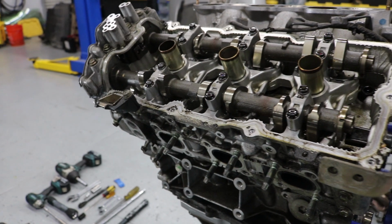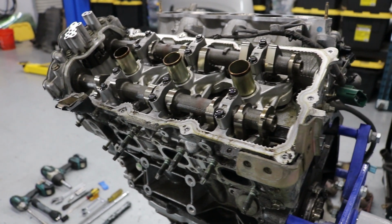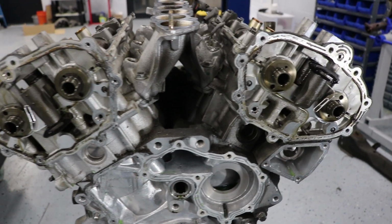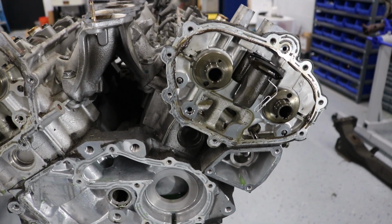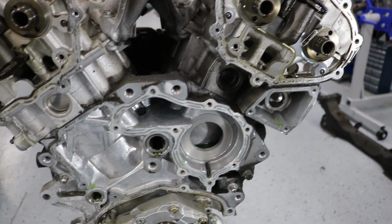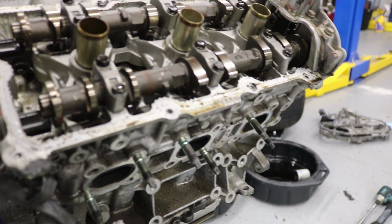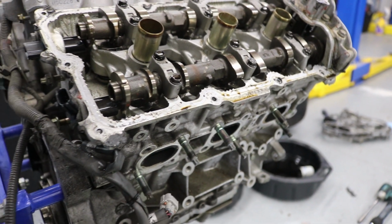I removed the exhaust manifolds, the front and rear timing covers, the timing chains, the sprockets, the water pump, the left bank valve cover. I removed the secondary timing chains, the upper oil pan, and all this is left for the next video.